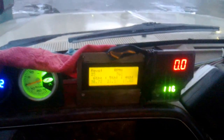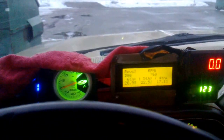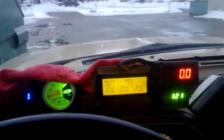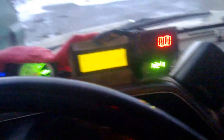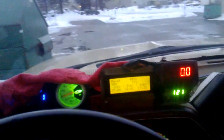Have to reset it. Now we're at 760 and it revs a bit more nicely. So that's kind of how you adjust the governor if you need to. That's just adjusting the governed overall length — when you adjust the overall length, what you're doing is adjusting where you're pushing back on the governor plate, how much pushback at a particular throttle position. The longer it is, the more pushback, which means the higher the revs or the more fuel being added for a given RPM. So you shorten it, it lowers the idle, lowers the thing.